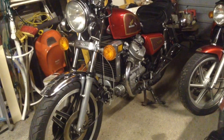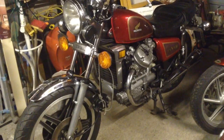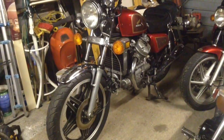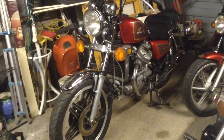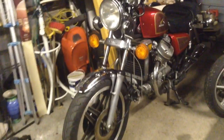But when I pumped the tyres up, I had to wheel the bike outside towards the car, so I could get the compressor to the tyres effectively. It was the easiest way to do it. And by the time I wheeled the bike back in, it was really difficult to push. So by all accounts, just operating the front brake, both calipers are seized up.